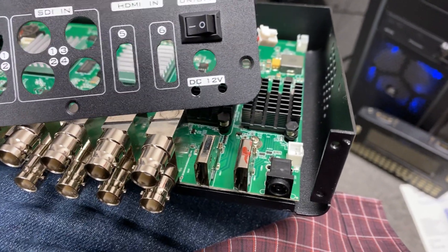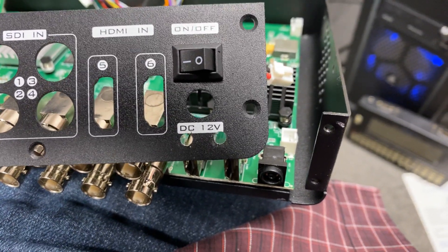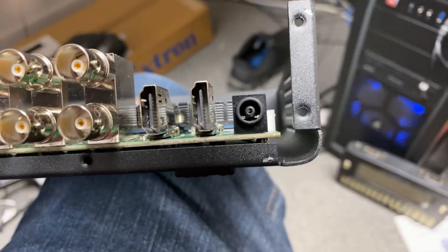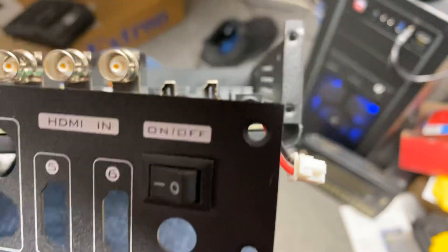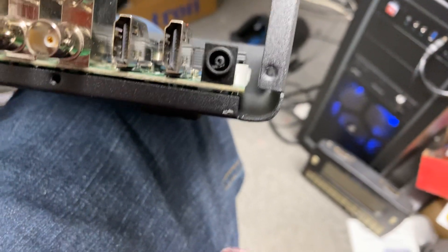For those of you who don't want to drill into their case, you can get a locking connector kit — for instance, drill one hole, tap it, and screw in a zip tie-like fastener. But be careful, because if you drill right into it, you'll either drill into the circuit board and damage a trace, or drill right into the power connector. There's really no other safe place to drill except to the side, between these two screws at the top and bottom, where there is some room.